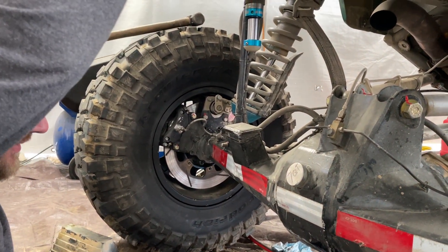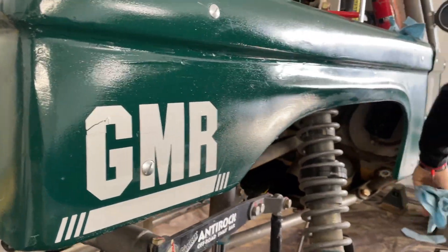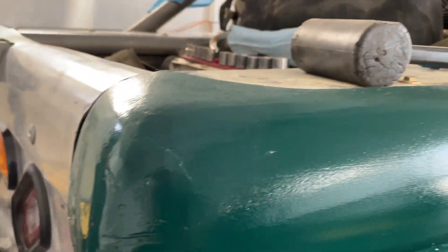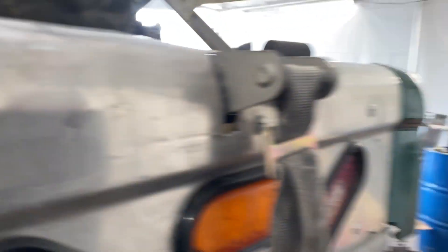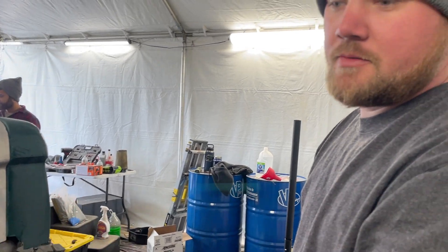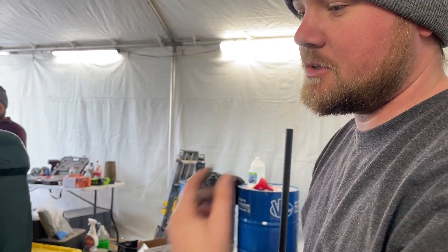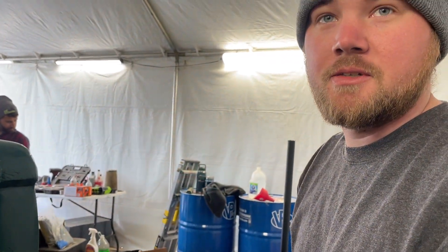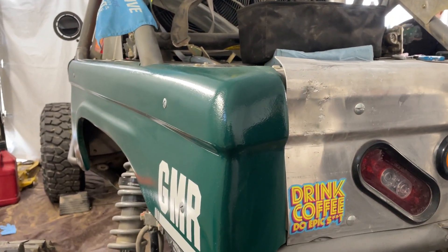Should be good to go — we fixed it this afternoon. Did you guys get the brake stuff figured out in front? Yeah, we put in two new calipers. We blew out the calipers on both the driver's side front and the driver's side rear, so we replaced the calipers, replaced the rotors, had to bleed everything. Ran all the fluid out of the car, so we had to put the brake fluid back in. Should be good to go.